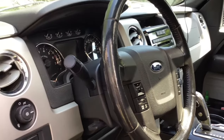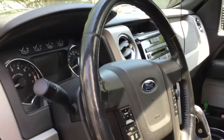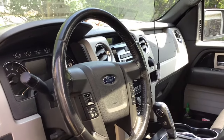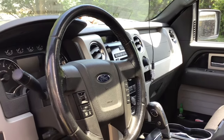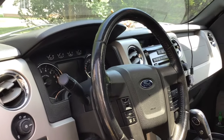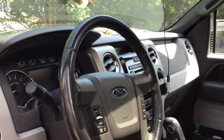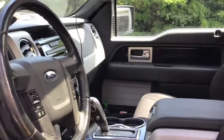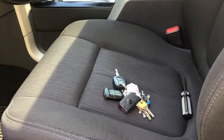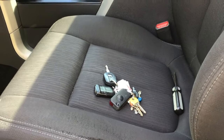I can show you how to remove that light if none of your sensors are bad. You will get a light if you change or rotate the tires and don't do a relearn. That light will not go off by disconnecting the battery or anything else unless you fix it — either relearn it, or if there's a sensor failure, replace the sensor, program it, and then relearn.